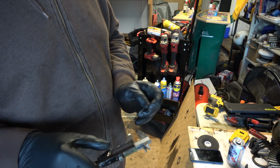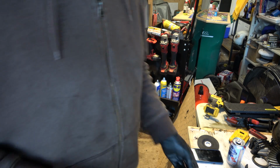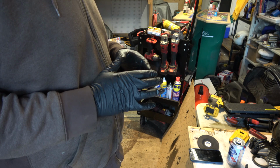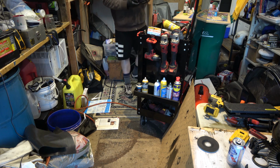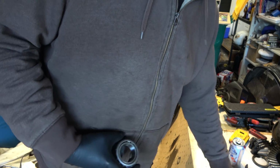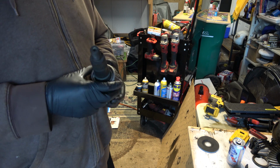This is the factory one. We're about 2/1000ths of an inch there. So what I'm going to do is start with the factory shims, even though we have a different carrier and a different set of gears. So I'm going to grab my pinion. And the bearing that goes on that end is this one right here. So you'll throw a shim on there just for demonstration purposes, and then your bearing you'll press on.